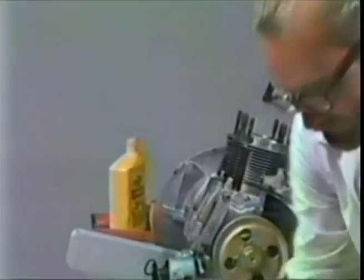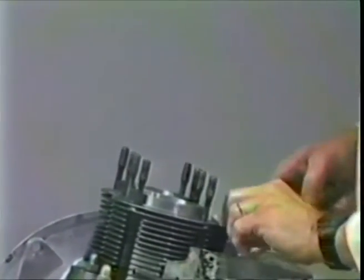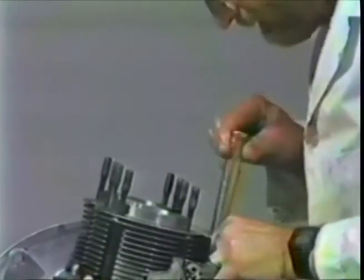All right, so pardon my movement here. Get out the secret sauce. Pour a little, or take your finger and put a little secret sauce on each of the pushrod tube bevels. Get out the pushrod tube with the air deflector. Check to make sure the air deflector will miss that washer. This time it does. We don't have to really cut it out. Make sure the seam is up. It is. Stick everything in place.